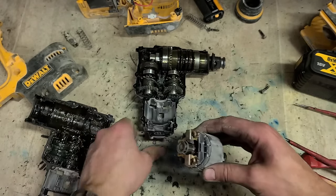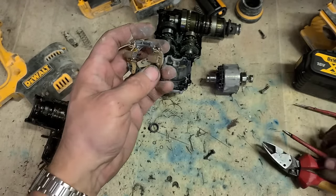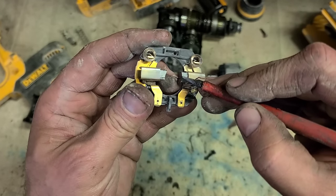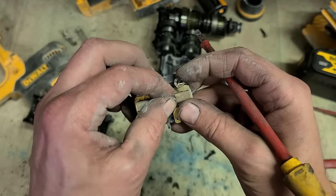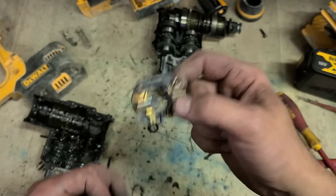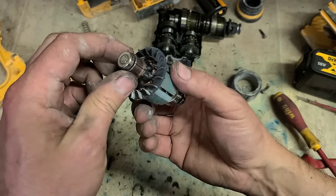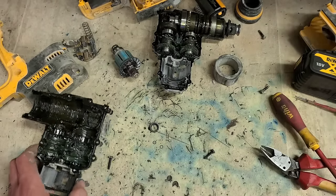No, it has the motor. Brushes are burnt away. Or more so, overheated. And cracked. So they've cracked and expanded, so they're not going to be moving on the holders anymore. So it's actually the brushes that's the problem. Hopefully it's the brushes. There's nothing wrong with the armature itself. She does sound okay, mind you. Give that a wee clean out. We'll clean that down as well.